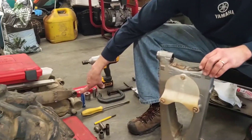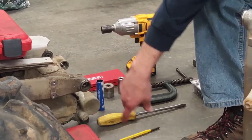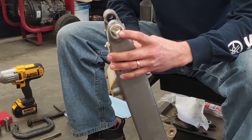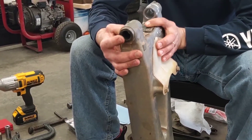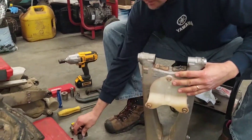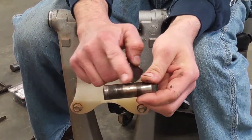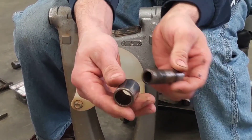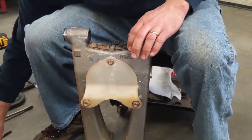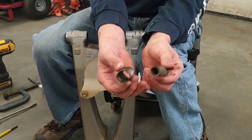This down here is a swing arm out of my friend's four-wheeler, which he let go for way too long, and the bearings got destroyed. What I have here is a replacement swing arm that he had to buy. This side I've already pressed the bearings out of. This side, you're going to watch me press out, and we're going to press some new bearings in. This is what's going to come out of the swing arm — this bearing is no good. The surface is all rusted, the little needle roller bearings inside are all dried out. It should not make that noise. This is what actually came out of his swing arm because he let it go so long — notice there are no needle bearings. So that's what we're going to change today.